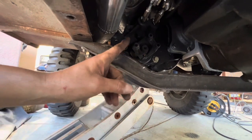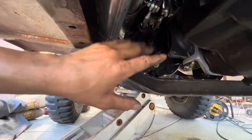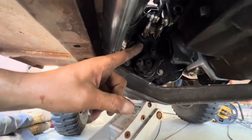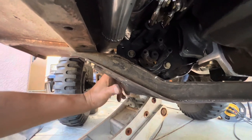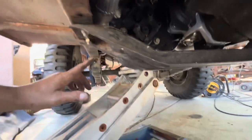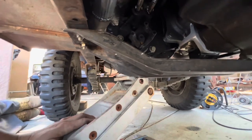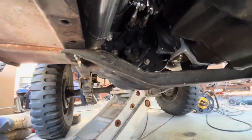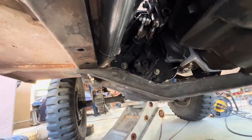We're going to put this L-bracket like this, and that helps with the torque twist. On a Dana 18 you have a bolt up there with a little rubber donut piece that automatically bolts right into your cross member — the Dana 18 already has one built in. Dana 20s do not, so it kind of just hangs there. I learned the hard way at the FCT in Colorado, and Mike Picard helped me out putting that bracket on there. When I got back home I gave it a little notch, and everything's been good.